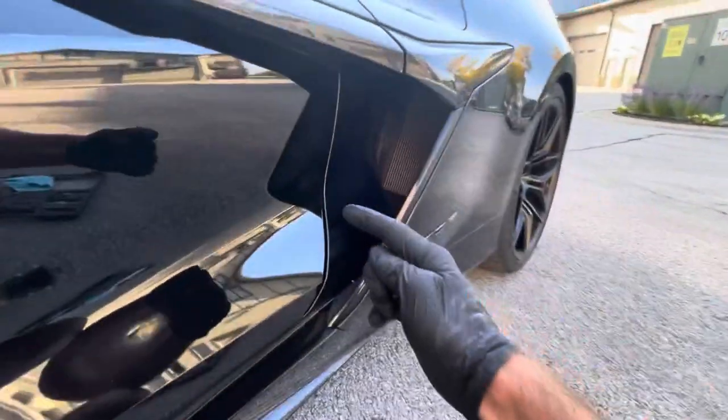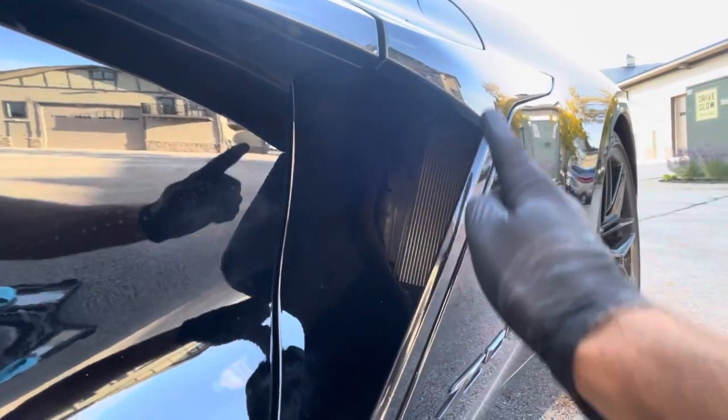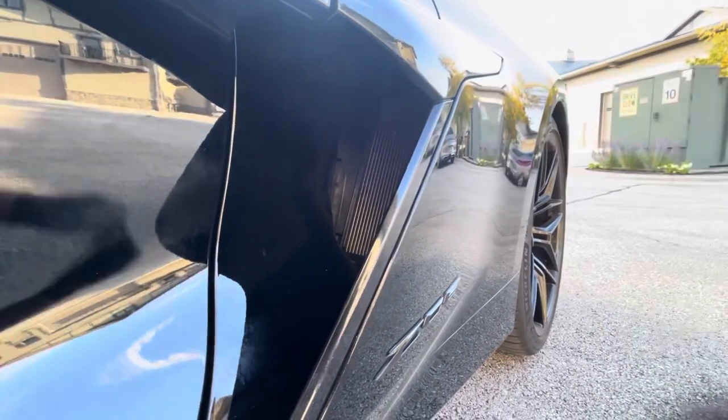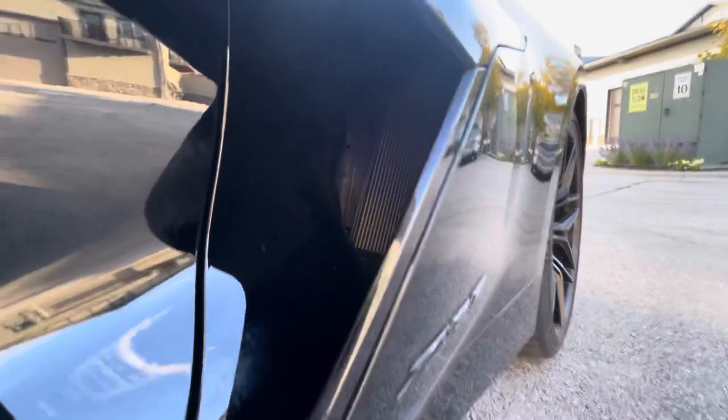We're going to go in here and we have one screw, one nut right here, two, and the third one. So one, two right here, but there's also one up here — so one, two, three. We're going to remove that nut with a five-sixteenths wrench or socket, and we're going to be placing the inner side of the grille into this rubber right here. We'll stick it in here and it's going to conform to this area, getting that inner edge through that rubber, and then we'll put the bracket up onto the second or third nut.